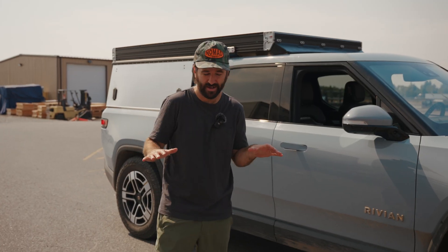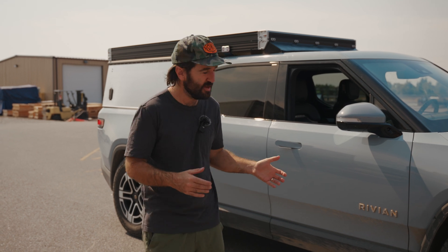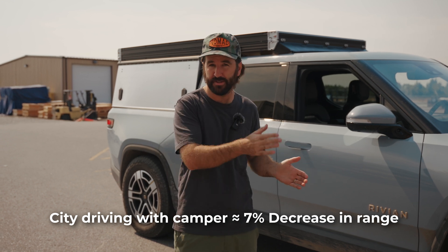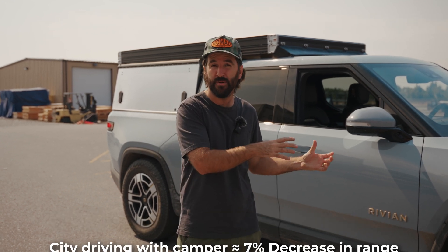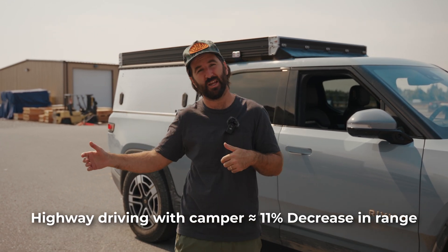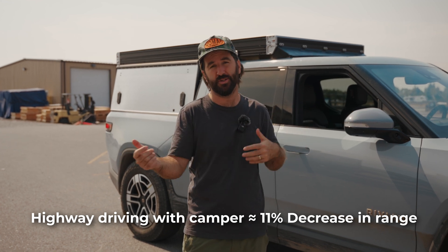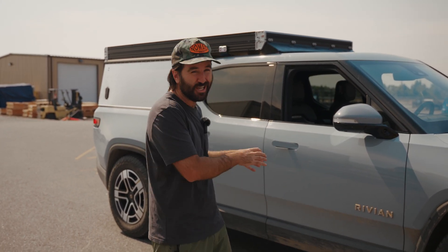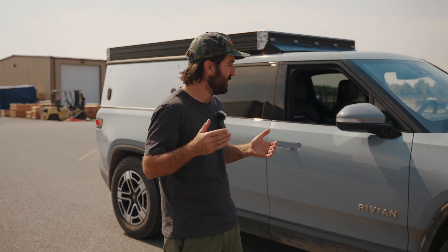It's really hard to get perfect data across just a small sample size of 60 miles, but what we did see was about a 7.5 percent reduction in range at slower speeds of 35 to 60 miles an hour in that high-wind environment, and about 11.5 percent once we mixed in highway driving with big headwinds and crosswinds. Compared to our Bozeman to Idaho Falls data at 9.5 percent, we really need more testing. The TLDR is that we're at that 10 percent range, which is what we were targeting or better.